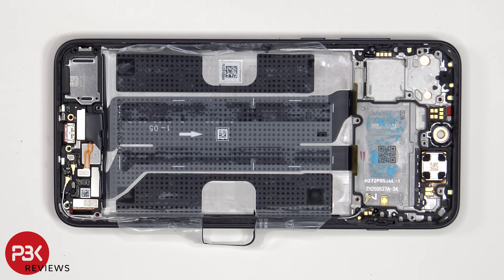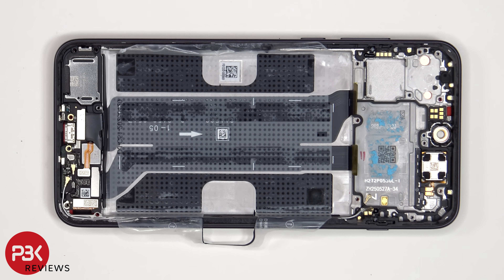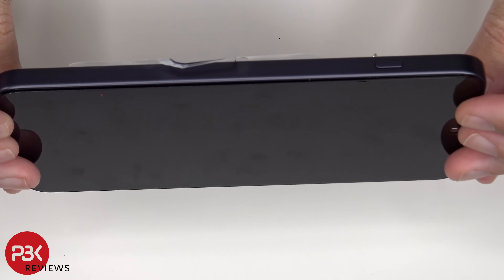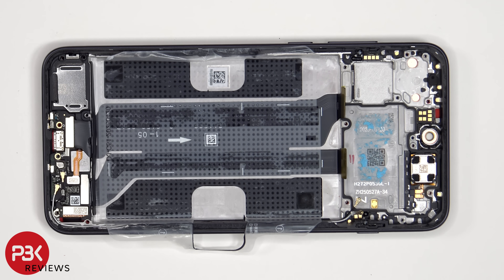Once the plastic cover over the subboard has been removed, we can see the flex cable for the screen which is attached to the side of the subboard, as well as the flex cable assembly which connects the main board to the subboard. If you needed to replace the screen, you'd have to remove the back plate, the bottom subboard cover, and the cover itself. Disconnect the flex cables and remove the subboard, giving you access to the screen flex cable. Pull out the red rubber gasket by the screen cable, heat up the front of the phone to loosen the adhesive, pry the old screen off, apply new adhesive, and reapply the new screen making sure you run the flex cable back through the opening in the midframe, then reassemble the phone.